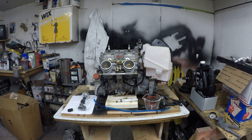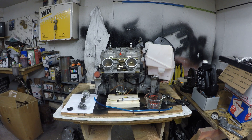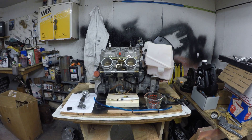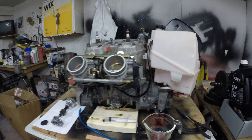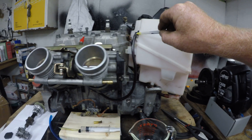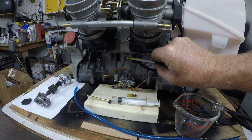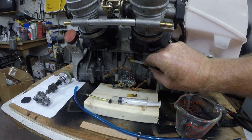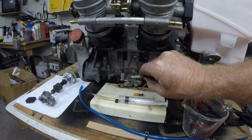This is a short video showing the easy way to fill the cavity in a Rotax engine where the oil pump gear is. If you're familiar with the Rotax engine, this line here comes from the oil tank and it's a one-way line to the central cavity where the gear is that drives the water pump on the other side and the oil pump on the front.